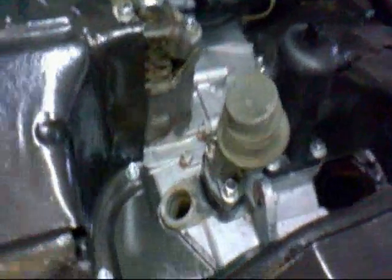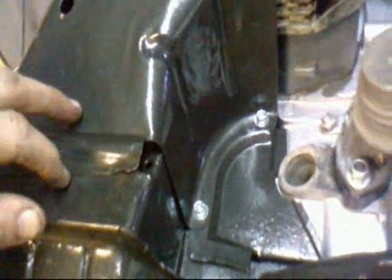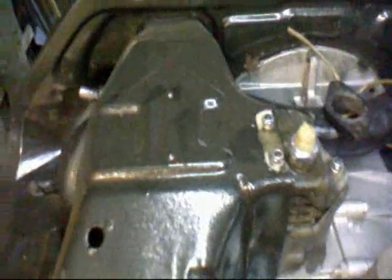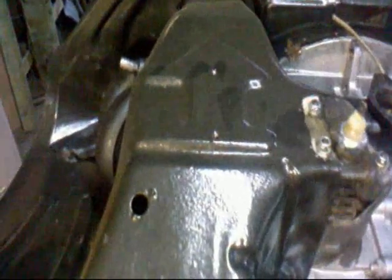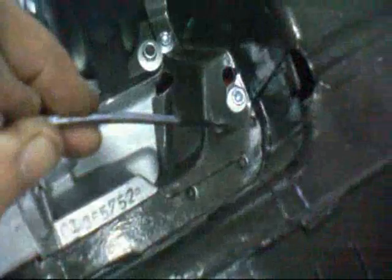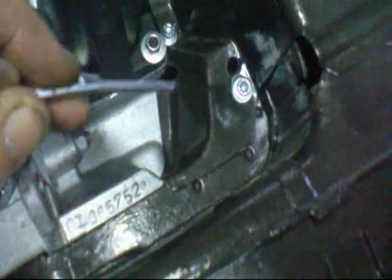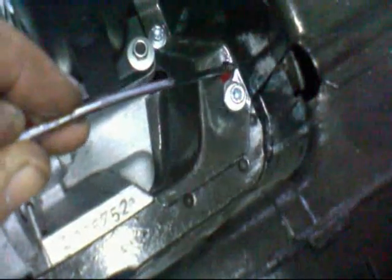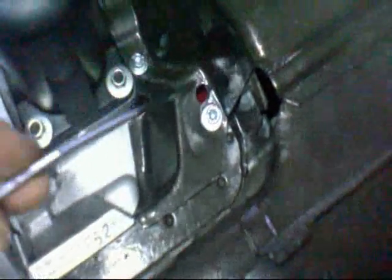What we will be doing is putting a band of tape to make all this as airtight as possible. On all air-cooled Volkswagen engines, try to avoid having holes where airflow would be lost. This little piece of tinware where the dipstick goes through is now fitted. We're going to be blanking off that little hole because we haven't got a cable coming up to operate the flap mechanism.